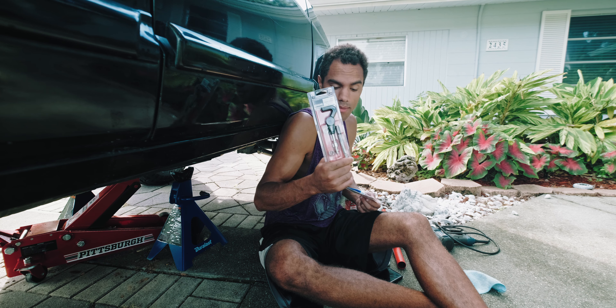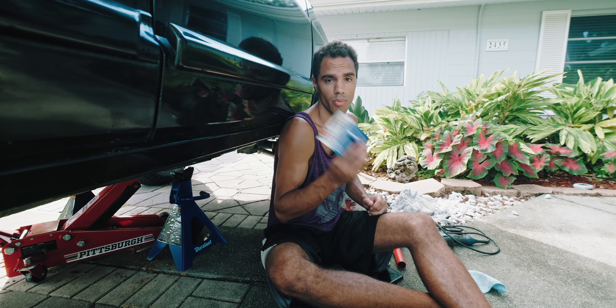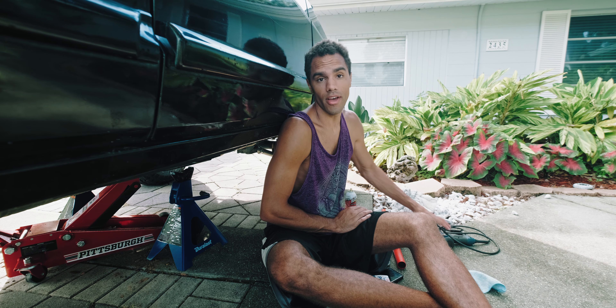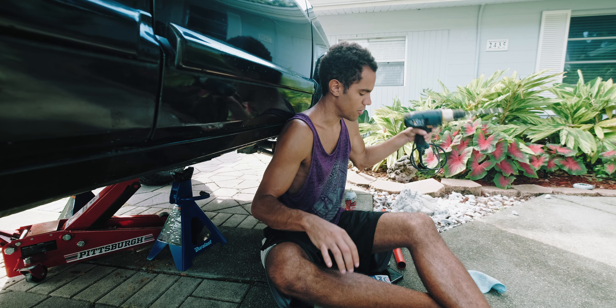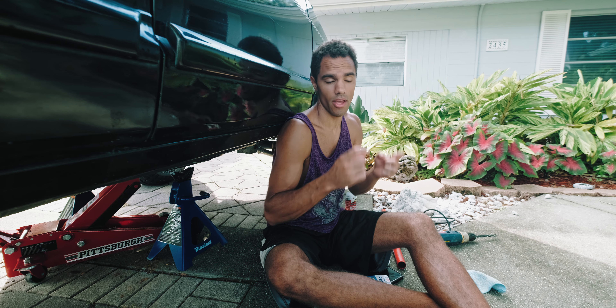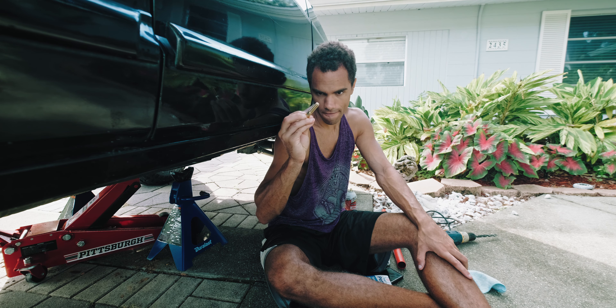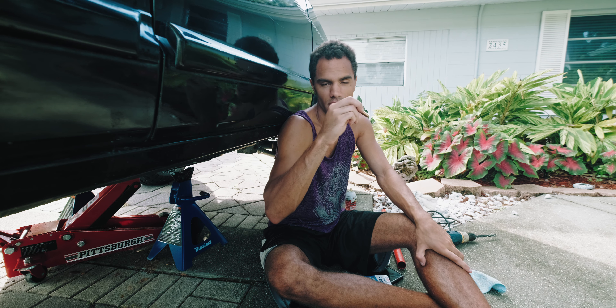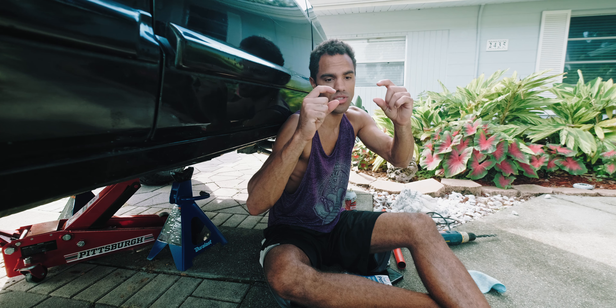I did get what I need, but it's raining. I think I'll just let it sit for the night and finish up in the morning. All right, it's the morning — I got the tap kit, the new bolts, and washers. Online people were also using threadlocker, so I got the blue kind. They also said you may want to drill out the cross member hole so the bolts fit easier. I decided to only get two bolts since only the two front ones are stripped. I think it got stripped because when I was trying to put in the bolt it was binding and probably bent the weld nut inside — that's why it won't grip anything.